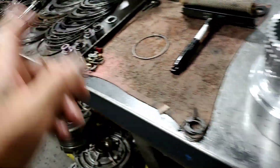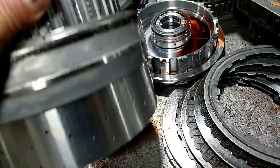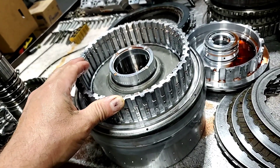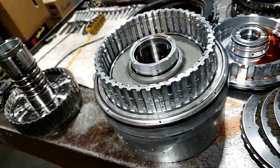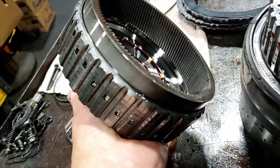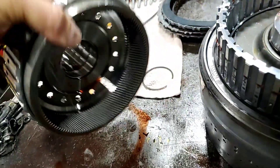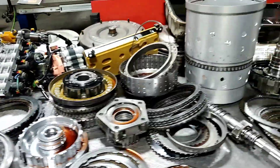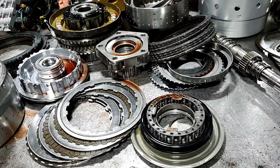For some reason this drum is more expensive than that one. The bushings are about $100 for the bushing kit for the 10R80s; for the 10R140s they're not available yet. But you can see the bushings are the problem — this is the hub, and you can see they are worn out, kind of a gray shade. The 10R140 has the same exact issue as the 10R80s.